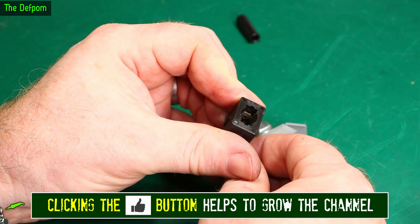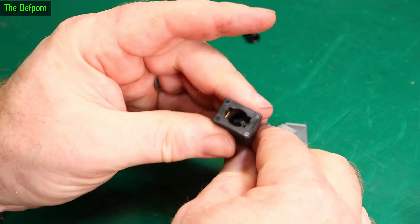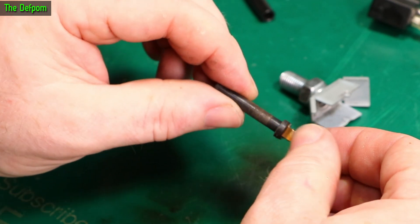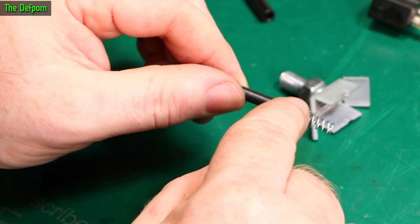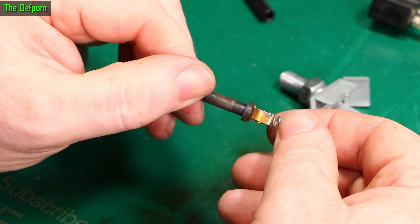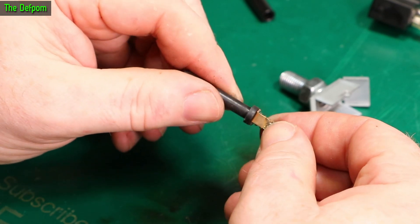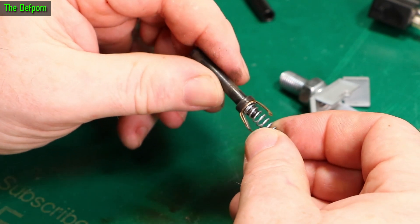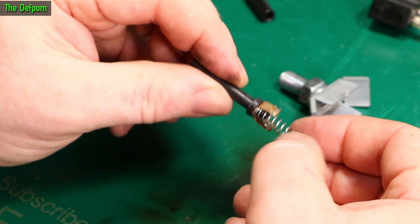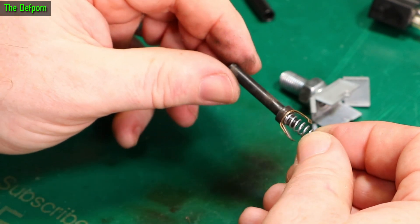These are crimped straight onto these wires, and these look just like blade terminals shoved in there. So what if I can actually pull those out? There's probably some kind of tiny lug in there. That's cleanable. Here's the plunger — you can see there's a bit of an issue there, and this has had a lot of problems. So yeah, you can see that's been having a bad day. Really the switch should be replaced. I measured about 3.5 amps going through this thing — it's not that much current, but if you've got a dirty contact or it's only barely touching, that's going to cause a problem. That's probably what happened — it hasn't pushed back in far enough, just sitting on the edge there, and that caused it to fail.